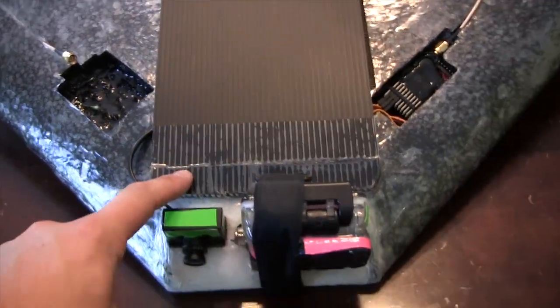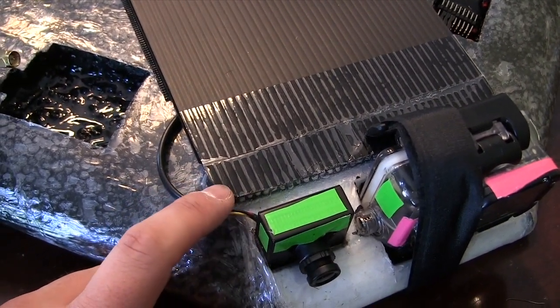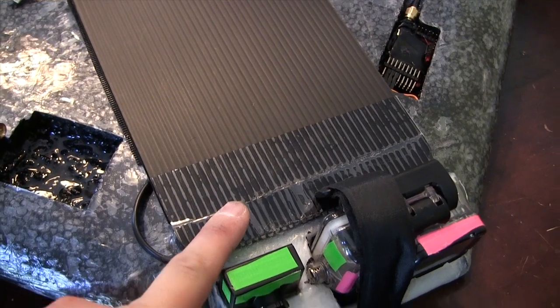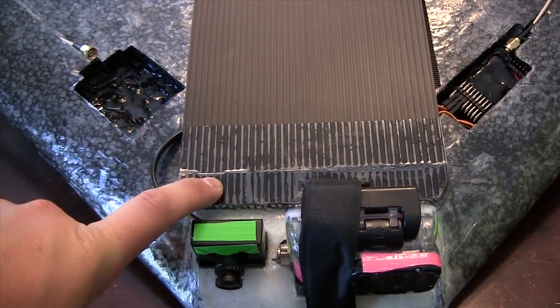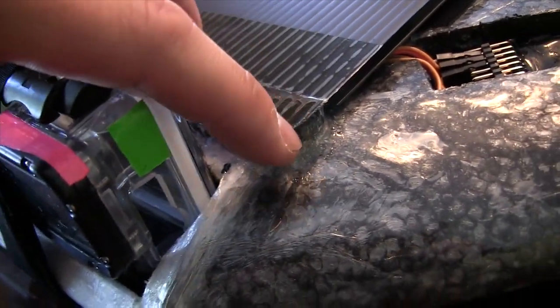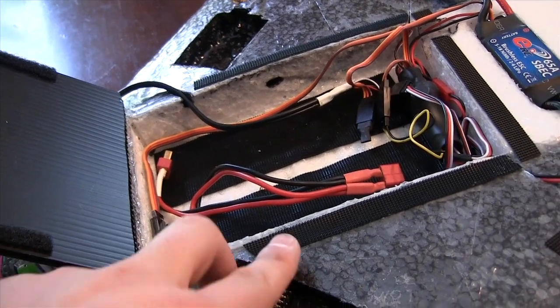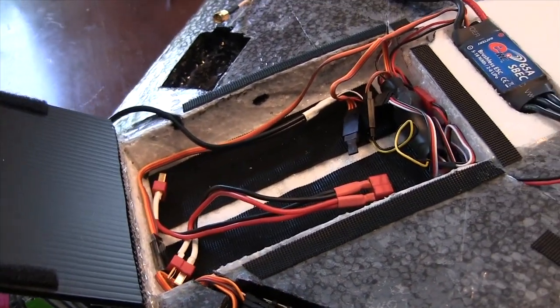Coroplast cover, and then what I like to do is, I'm kind of getting this formula down. I'm rounding the corners, I put a nice bead of either Goop or welder's adhesive down, throw it in place, and then slowly work a nice bead of Goop in so everything's nice and smooth. Gives me a little bit more room under the bay so I can dig it down deep, but then basically not have to drop it down and lose, you know, a quarter inch.